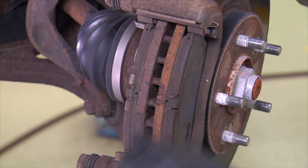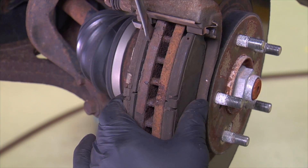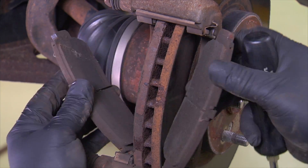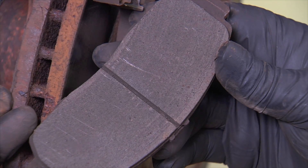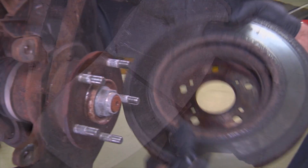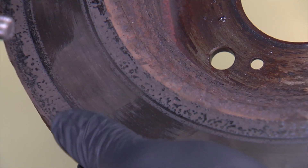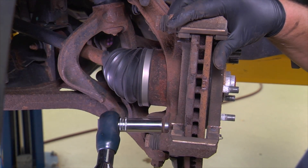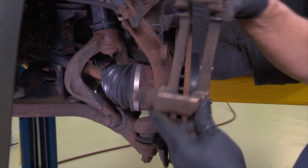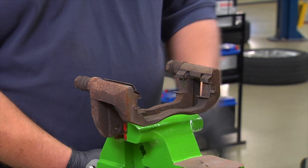If the brake pads are hard to remove by hand or they have to be pried from the bracket, corrosion and dirt have built up under the abutment clips. Simply changing the clips will not allow the new pads to apply and release properly. This is why the bracket has its own service procedure during a complete brake job. Examine the face of the friction material for heat cracks and unusual wear patterns such as stepped wear, possibly from the rust ridge on the outer and inner diameter of the rotor. All rotors have these rust ridges. Remove the two bolts holding the bracket, then remove the bracket. The pad bracket is where the majority of brake issues occur, which is why it's so important to service this component.